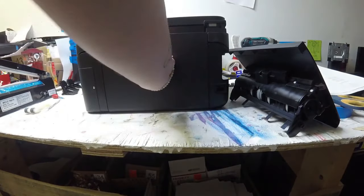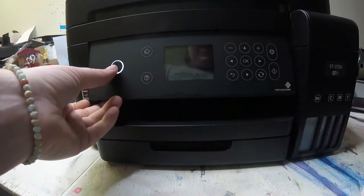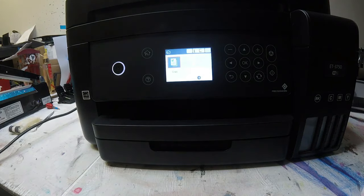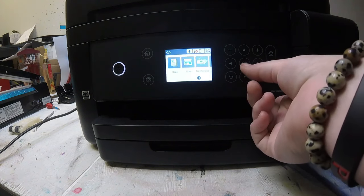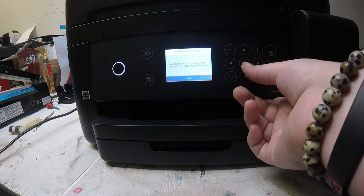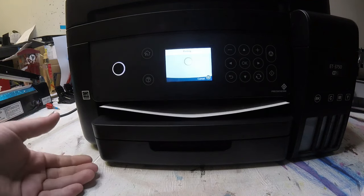We don't see it inside the printer or anything. But I replaced that duplexer with another duplexer that had that gear. And once I powered this on and I ran a print nozzle check, it ended up printing out for me. So Kevin's going to work on trying to 3D print some of those gears to place onto the duplexer. That way you don't have to replace the whole duplexer. We can just put one of those gears on.